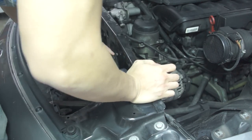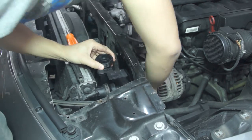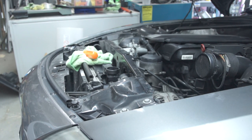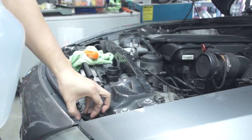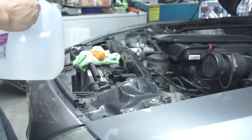Knowing me, I decided to just buy myself another expansion tank, and that's what you see me installing here. I just wanted to give you guys a couple of pointers. In terms of getting the expansion tank out, you just have to take off the hoses — other than that, it's yanking it straight up. Afterwards, getting the expansion tank back in is just the reverse.